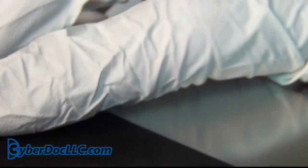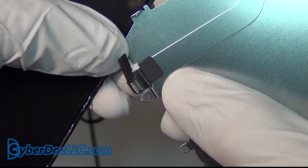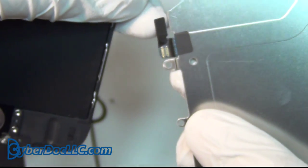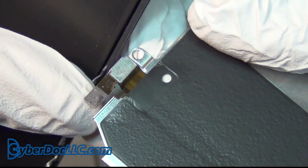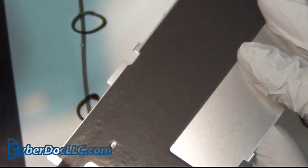I think it's probably best to grip on this end because you have more leverage. If you pull this part, this part needs to come loose first — then you pull from this part because it has more leverage. When you get to the button part, it looks like a support. In the future when you do this, put a little heat on here — that will loosen the adhesive and make it come out easily. You don't want to rip this off. This has a connector that goes here; if you only pull here without releasing this part first, it will come right off, and you don't want that. You don't want to rip off a cable when you don't have to. Hopefully in the future when you buy these parts, this ribbon cable will come included.